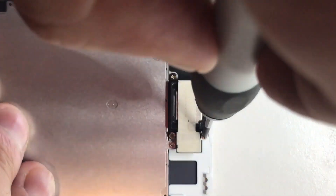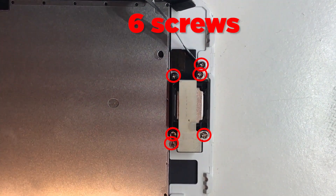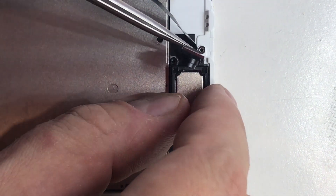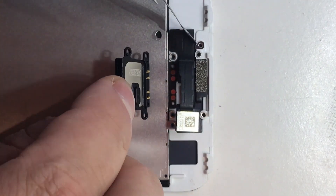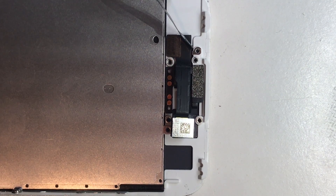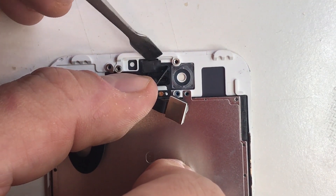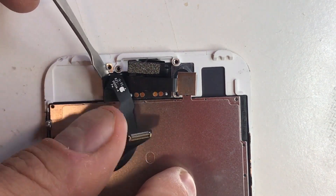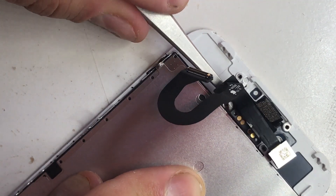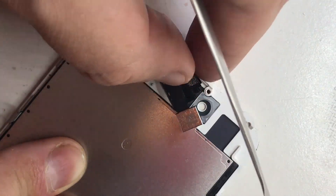Now on the screen we remove the six screws holding the speaker and the front selfie camera — six screws in total. The plate easily pops off. Then you just need to fold the camera to the left and remove the ear speaker. Now being very careful you need to pry the actual assembly off — this is just stuck down with adhesive, so be very careful and get in between the flex cable and the actual frame of the screen, and it should pop off.